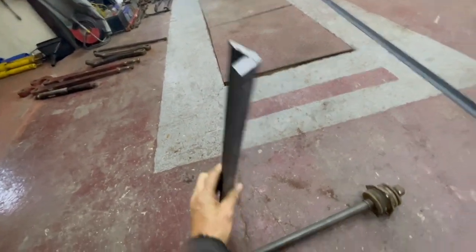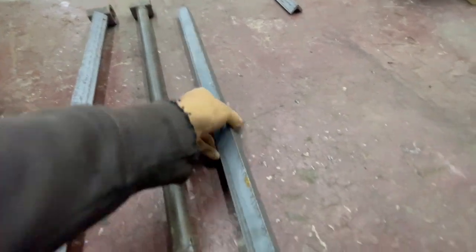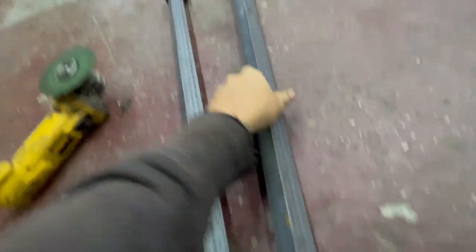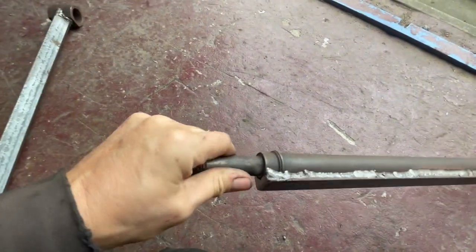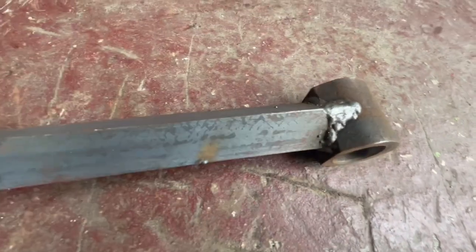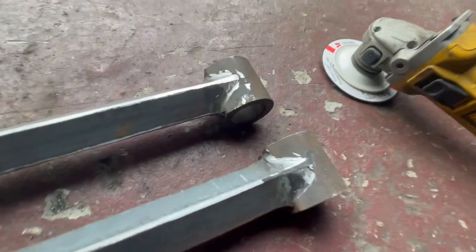I'm cutting a section and welding it all on - DIY. Got them cut out, go around the fusion welds at the two flat points and they fit over nicely, flush on the bottom of the bar. Welded them all up, smoothed them off front and back edge - nice and tough, big blob on there as well. Same with both sides - they're ground back on the edges too.